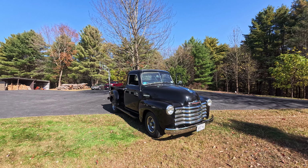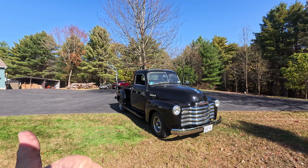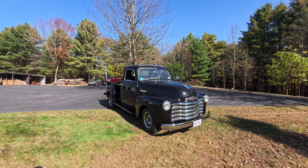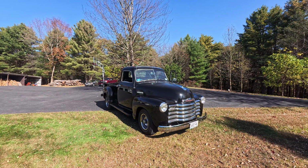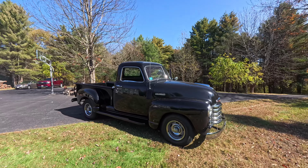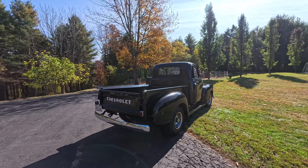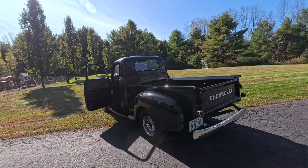All right, before someone mentions it, there are two major reasons why a vehicle like this will be burning blue smoke, which means burning oil. Obviously, the valve stem oil seals and the piston rings. However, I already discarded the piston rings because that engine has a ton of power. So I know those piston rings are good. However, I am going to do a compression test sometime in the future, even though I think I don't need it. But I will take care of those valve stem oil seals. Oh yeah, it's got power.